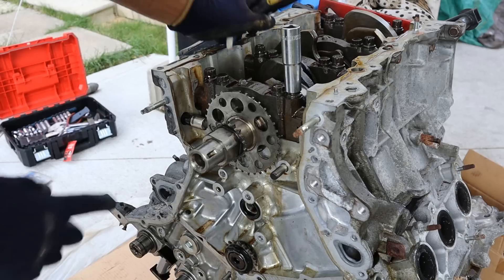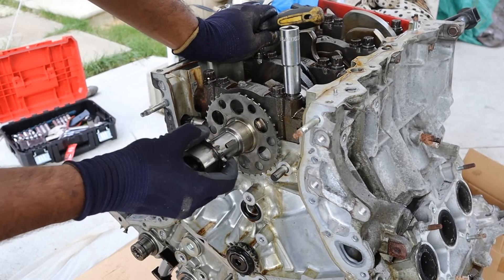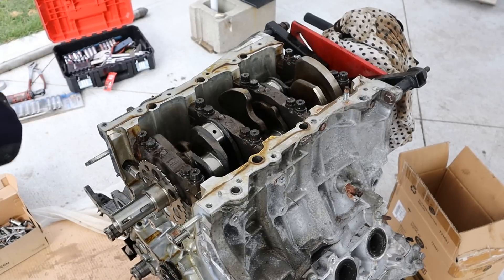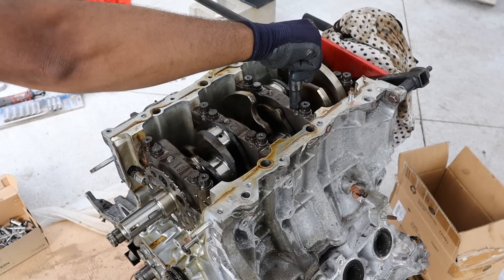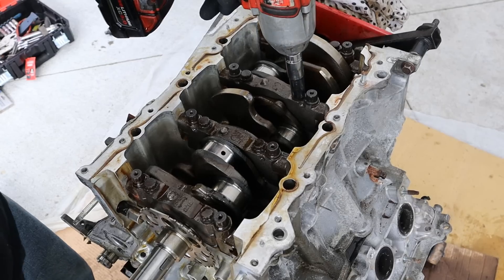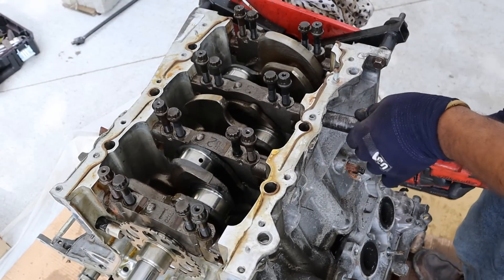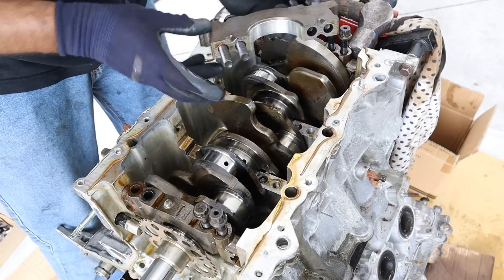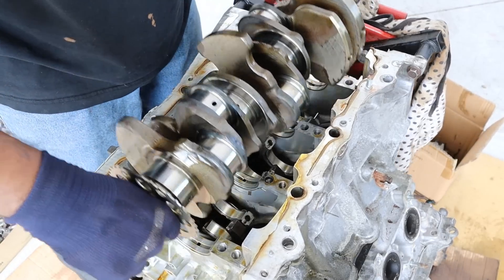And this is your timing kit. At the top you've got your crank position sensor and this wheel that's pressed on, and here is the crank gear. Last up before I flip the engine over, let's get this crankshaft out of here. I'm going to knock off these 14mm 12-point bolts. Also, let's not forget that these are cross-bolted mains, so I've got to remove the bolts on the side of the block too. Now I can remove the crankshaft from the block.